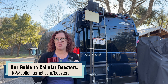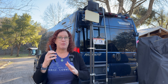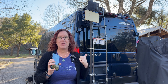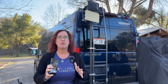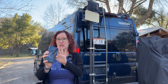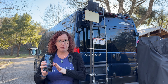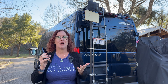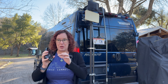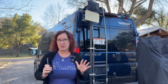We have a full guide that goes over boosters so you can understand how those work. Another option is if you have a cell phone and want to take voice calls, but your carrier isn't getting good signal inside your metal RV or boat — if you do have a solid internet connection, maybe provided by Starlink or a router with exterior antennas, you can connect your smartphone to your Wi-Fi network and enable Wi-Fi calling, placing calls using your internet connection rather than your weak cellular signal inside your RV or boat.